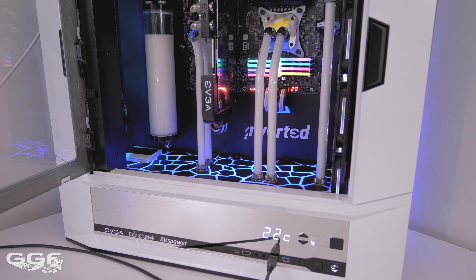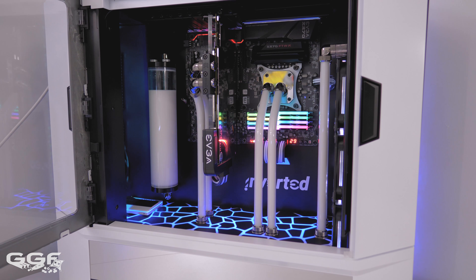Lastly, the PC specs I was running the screen on: my EVGA mod build with a 7700K, an EVGA Z270 The Win motherboard, and an EVGA 1070 video card. To run a screen of this calibre, that's roughly what you'd be aiming for as a minimum — a GTX 1070 for GPU, a minimum of a 7600K on Intel or a Ryzen 1600X on AMD. You're not going to be able to take a five-year-old PC and utilise all its features, especially the 100Hz at full resolution.